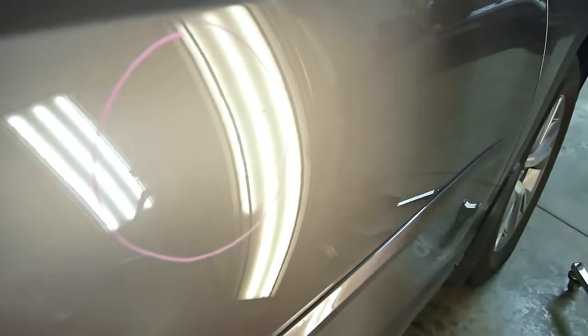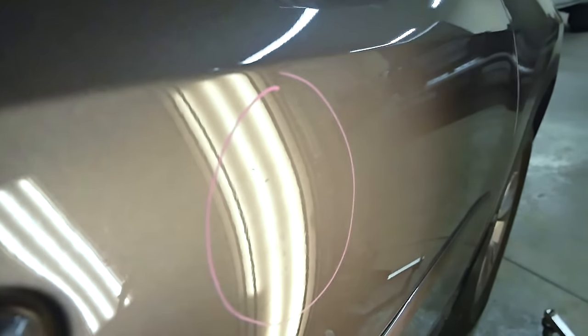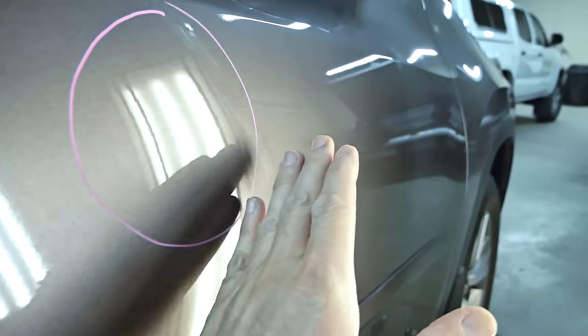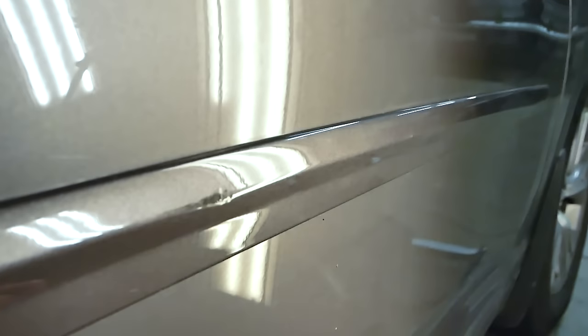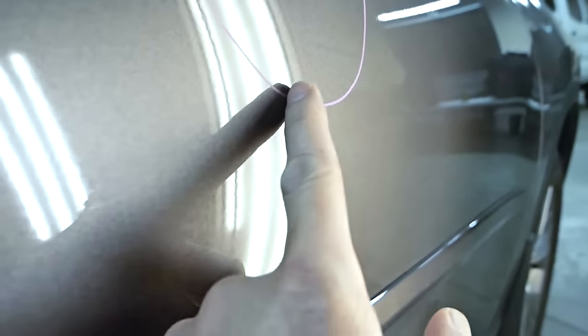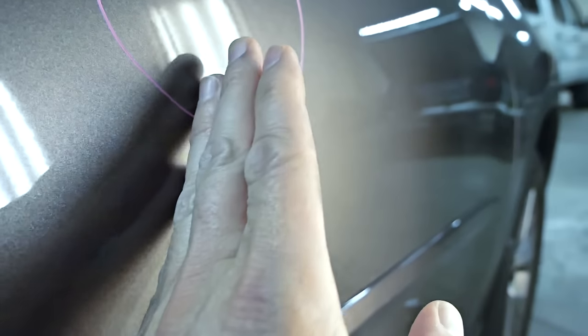Let's take a look at the finished result. Get up close — you can definitely tell there are no poke marks, none of those crowns left in it. It definitely looks great. The dent was in this damaged area, but once I had that light all the way back and right up against the panel with my head against the panel, I looked all the way along here and noticed this nick. So when the door hit, it didn't just hit here — it hit down the whole door. I wanted to make sure I got all the damage even down to there. There was a little bit of low area at the bottom of the original dent, and there were some low spots along the way. I was still flattening that out, and you can tell here — it's completely gone.